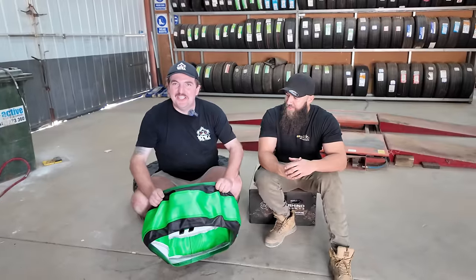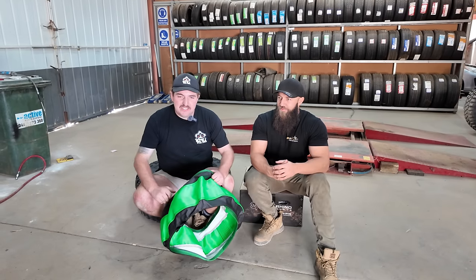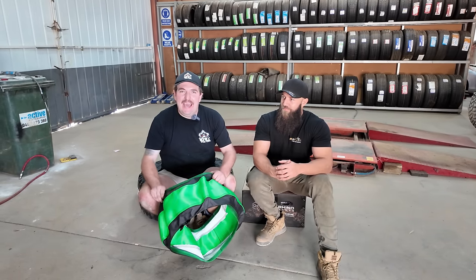That's it, yep. So I know you guys like a good story time from my first episode, so I'm going to tell you a little story. Basically, I've been defected a couple of times for my mechanical beadlocks. Mechanical beadlocks are great and really necessary off-road for the more extreme stuff. I know there's probably people out there asking, why do you even need a beadlock? We go four-wheel driving all the time without beadlocks. But being able to let your tires down to say 6 or 10 PSI without having to worry at all is a big advantage for some of the wheeling that we do.